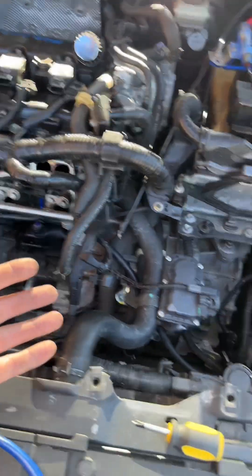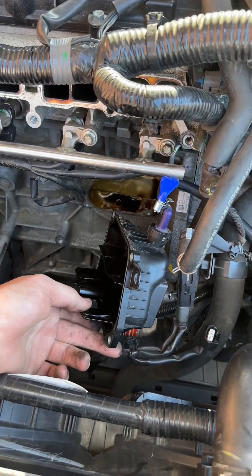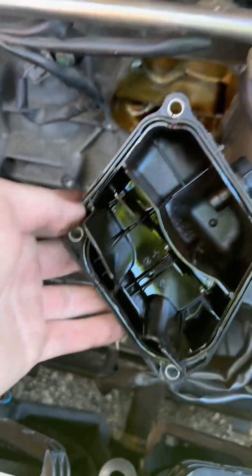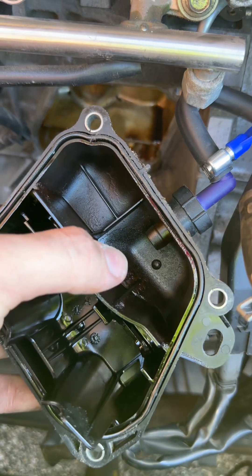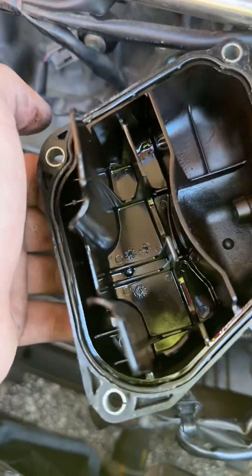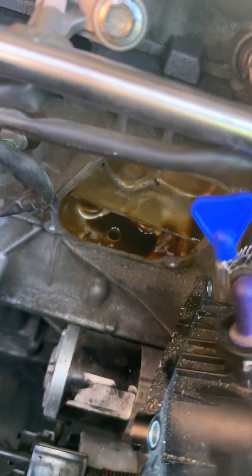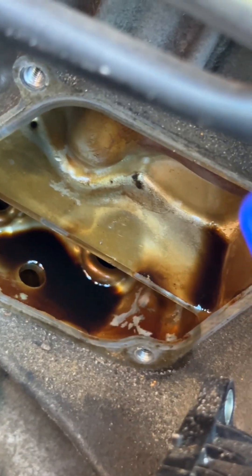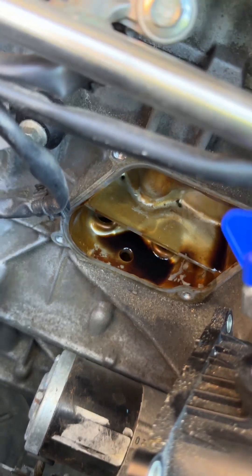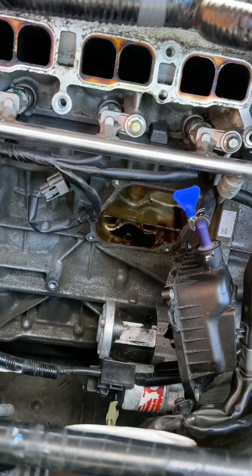After that you just put it all back together. Just as a good visual representation, this is the factory air oil separator here. You can see it's definitely shiny - it's got a lot of oil in it, and it's making it past all three baffles and into this top chamber where oil will just get sucked right into that PCV valve. Even though Mazda tried to kind of avoid this issue with direct injection motors, it clearly hasn't worked. You can see there's a lot of oil here, a lot of oil on that second built-in baffle plate. Especially with these direct injection motors, you just get a lot of oil past these baffles. They tried, but definitely a fail on that part.